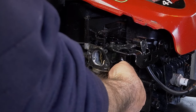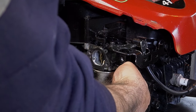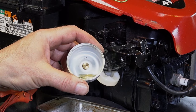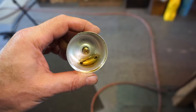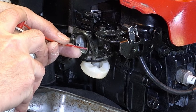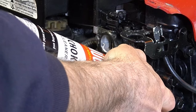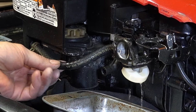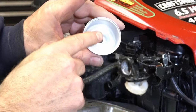Looks like there might be a little bit of dirt in there too — he definitely used it. I make everything clean when I reassemble, but see all the crap in the bottom? There's dirt and water in his tank. I'll take a picture. I sprayed out a lot and got in here good, through the jet passage where the main jet goes. Then I took this off and let it drain. We're going to drain a little bit more, change out the pan. I blew this out and used my jet poker — you can get those on Amazon. Everything's been blown out. Let it purge.